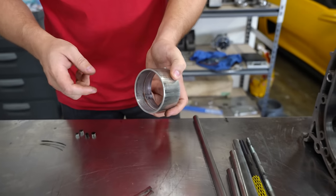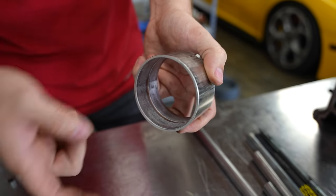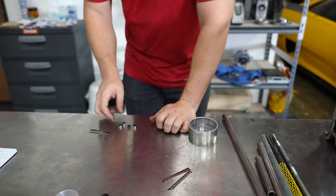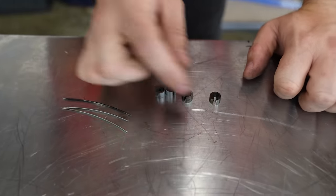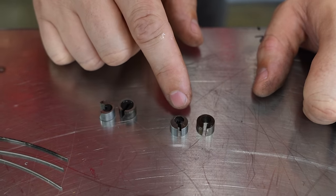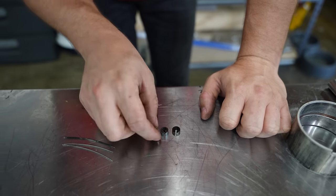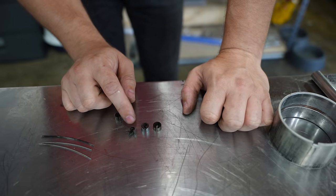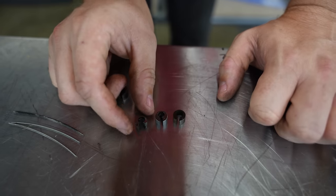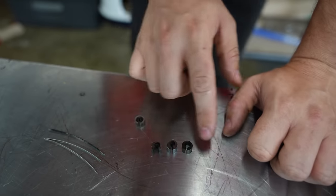These are bearings — this one had some metal inside my oil coolers, and that metal went into the bearings. Obviously metal going into any engine is bad, so it's not rotary specific. Over here are corner seals — this and this are stock corner seals. This one has the rubber still in it, but that rubber starts to eat away if you have ethanol. This one here is a corner seal on detonation — you can see it cracked the corner seal in pieces. Normally it cracks at the weak spot down here, but that one cracked up at the top and did a nasty number.